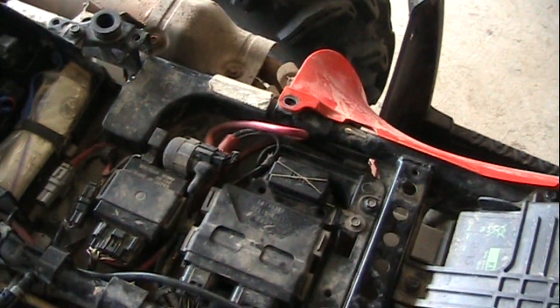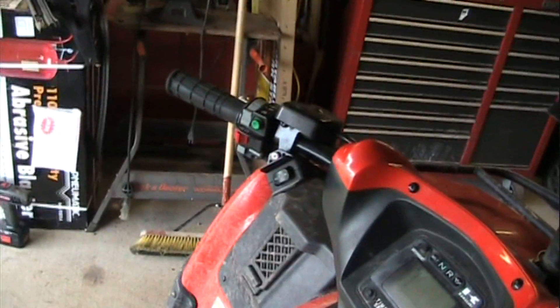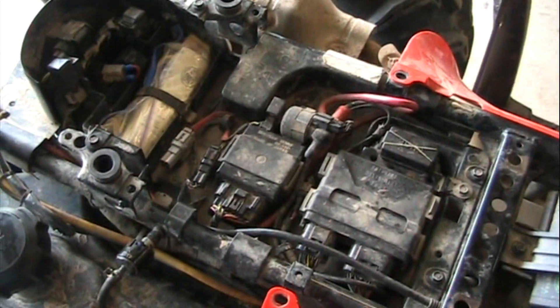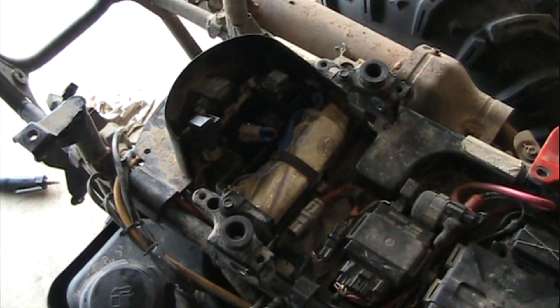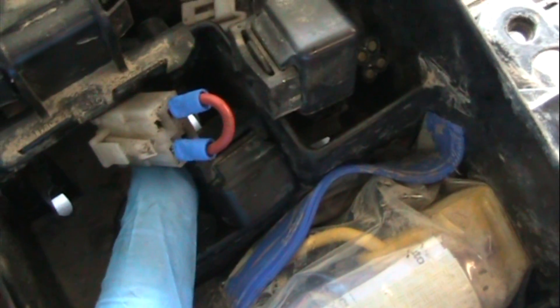The benefit is that it also allows the stock fuses to be part of the fuel pump power still. The downside is it's got the power running up and through the machine all the way up to the switch — all the power for the fuel pump is going through the switch. It's the same gauge wires running the whole thing; that's not the way it was designed. It's not the perfect long-term solution, but if the only part of your CDI that you fried was the ground to the fuel pump relay, then you've got at least a bypass solution — even a jumper you can build to get you home or bring out in the woods. Just a quick double crimp of two spade terminals onto a wire. That thing stays in there pretty good; get a zip tie around it and it'll hold.